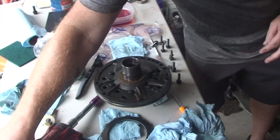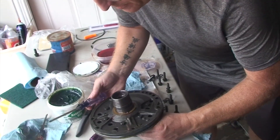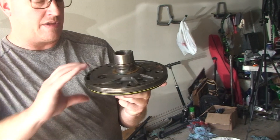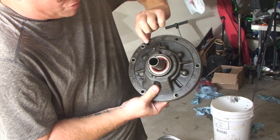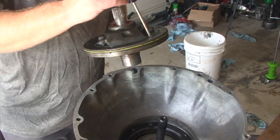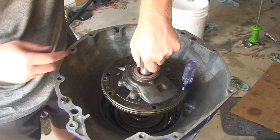When I put the pump in, one thing I like to do is use a Phillips head screwdriver — one that's skinny enough to go through the holes — because it helps me get it all lined up right. We're going to flip it over. If you look at the outside of the pump, there's a breather hole that goes somewhere around one o'clock. So I have some idea of how it's going to fit in there. I'll run the screwdriver so it fits through the hole and it's going to slide right in.